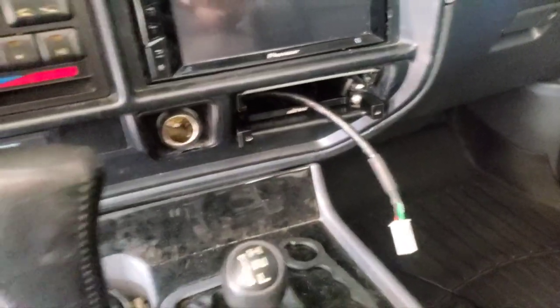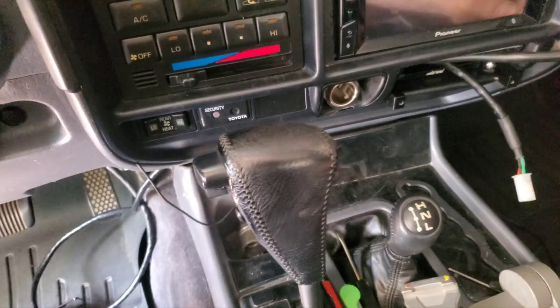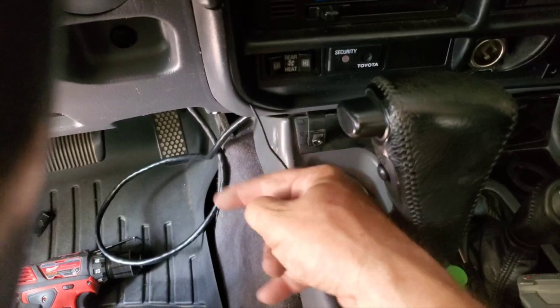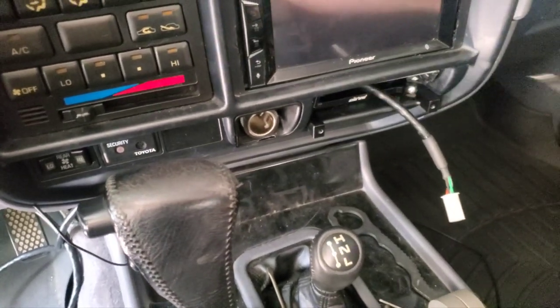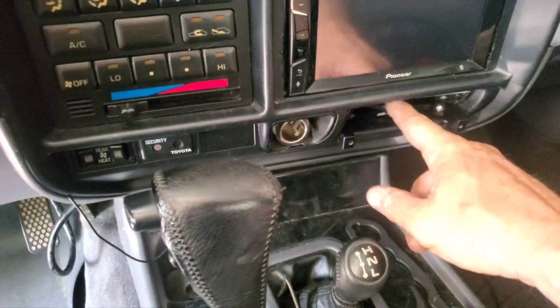Here's another little trick — it's really hard to find your way from under here. You're basically going about 12 inches to the next point. I took one of my old harnesses and pushed it through the bottom corner so it popped out the other side. You'll have to wiggle it — might take three or four tries. Once it came through, I taped the two wires together to make almost one continuous cable and pulled it through. Then untaped them — voila.